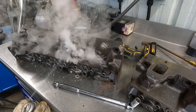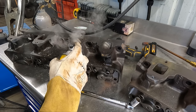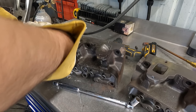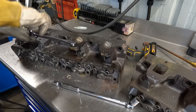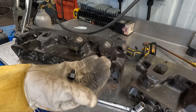Now I know it doesn't look like much movement, and that's where the patience piece comes into play. At this point I had a good feeling it was free, I hit it with the oil, and we just have to take our time working the bolt back and forth — it will gradually free up. If you just try to force it, it's going to break the nut off and you're going to be starting over again, just like I showed the first few times. But just like that, the bolt's finally free and the threads in the head are still usable.